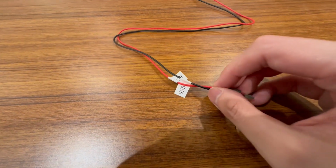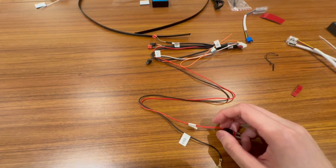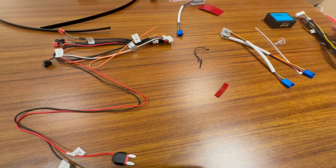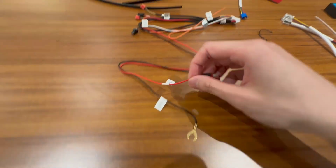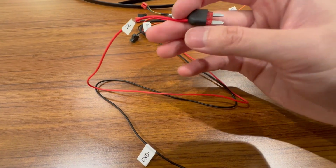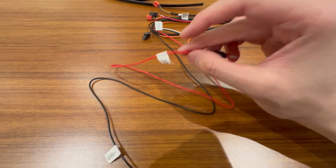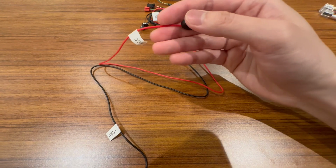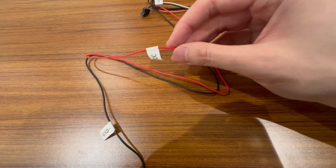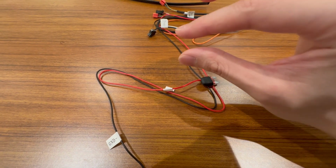So this is where we get the power for the master module, because the door plugs, remember, all we have to do is plug it on the window motor module, and it's very easy. For the actual master controller, you can do it this way or a way that you'd like with a fuse tap, but I'm going to show you this way. You can follow it if you want, or you could do it a separate, cleaner way. What we're going to do is cut this off and then strip the wire back, and then we're going to pull off the existing 10 amp fuse, which I'm going to show in this photo right here.